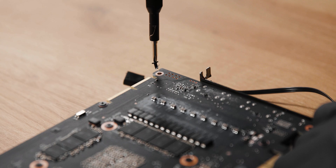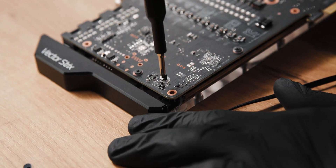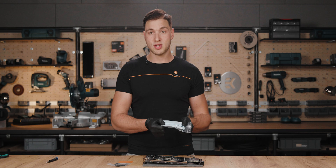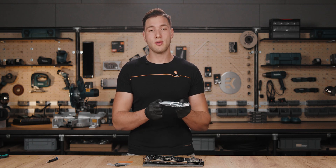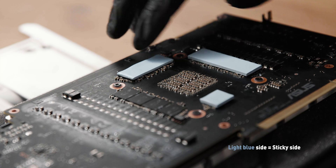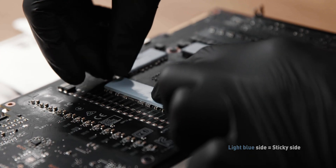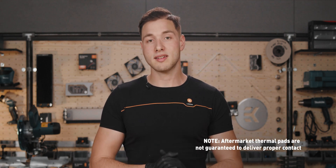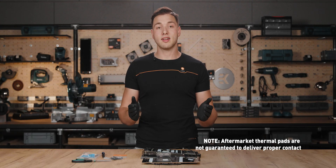Do not forget to remove the stock terminal as well. For this next step, we need to cut the thermal pads to size and install them according to the installation manual. Be precise, as the tolerances are really tight. You must remove the protective foil from both sides of the thermal pad before installation. In the end, it should look like this. Keep in mind, for this example we're using the Strix active backplate and the Strix block, so yours may differ a bit depending on the GPU of your choice. One thing to mention: if you change the thermal pads to an aftermarket alternative, they might not be able to get compressed enough for the installation. EK thermal pads are soft and get compressed a lot, and the blocks and active backplates are designed with that in mind.